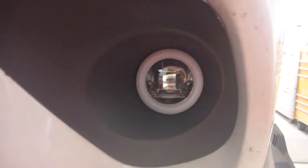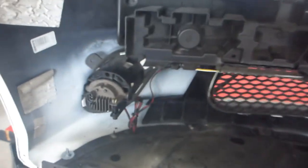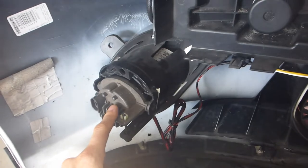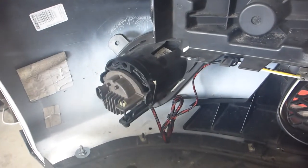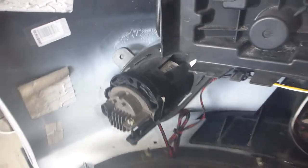First of all, we do have addressable fog light halos. Those are installed right there. As you can see, there's no halo mounting wire — it's very clean, it looks like it belongs there, and that's what we go for. So there's a two-step process just for that alone: mounting the halo to the fog light assembly, which has to be removed in order to accomplish that, and then mounting the diffuser, which I actually do to the bezel itself so that it sort of floats.